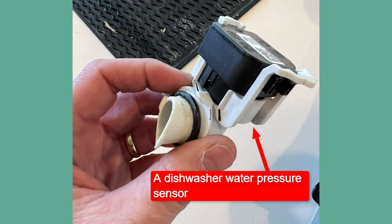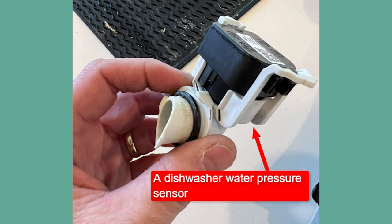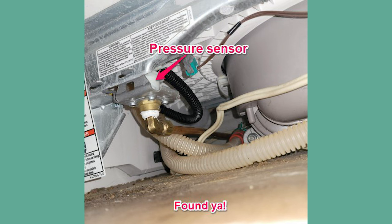It's not always about the water pressure, valve, or inlet hose. Sometimes it's all in the dishwasher's mind — by that I mean the pressure sensor, which is our next possible culprit. Assuming that you've got water flow that could rival Niagara Falls but your GE dishwasher's still flashing that H2O error, it could be because the pressure sensor is having a little hiccup. It's like the weather app showing it's raining cats and dogs, yet you can't see a smidge of clouds for miles. I had a client named Barry who faced a similar H2O error dilemma, and in his case the sensor was the drama king. This part is responsible for detecting water pressure, and when it throws a tantrum, it can fool your dishwasher into thinking the water pressure's low. Where's this sneaky sensor located? Dive deep and you'll spot it lounging at the lower back of your dishwasher, usually hiding behind the junction box.